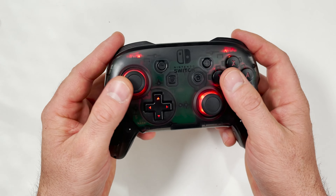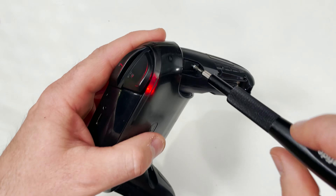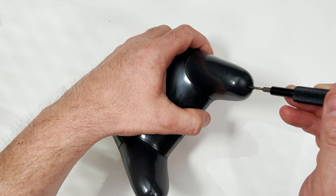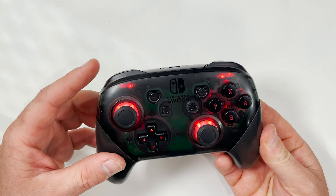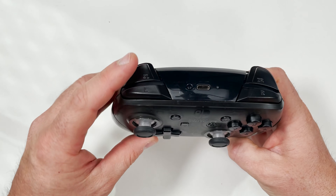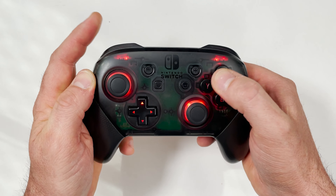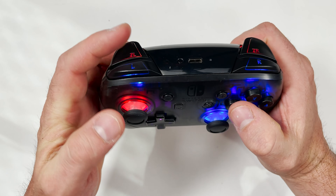And that's a win! The lights look fantastic so the next step is to put on the handles and I'll be all done. And now I have a Nintendo Switch Pro controller with LED lights. All the buttons feel like they're in place so now I'm going to show you how to change the colors. Hit the L button, right D-pad, and Y for 10 seconds and the lights will turn off. To turn it back on hit L, right D-pad, and the Y button and hold it down for 10 seconds. I found that I can also change the colors if I hold the L and Y button for 10 seconds — then it will start blinking and will go into customization mode. I can go through each button section individually and change the color. Pretty cool — it took a second to figure out but it ended up working really well.